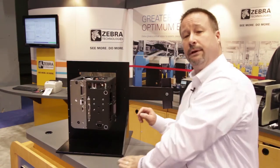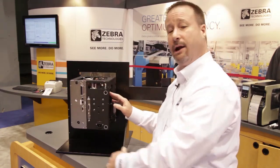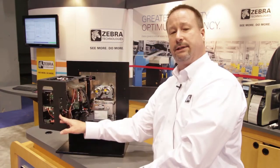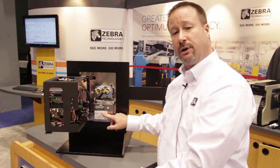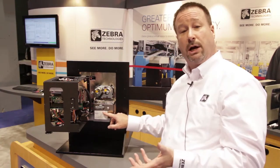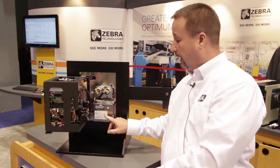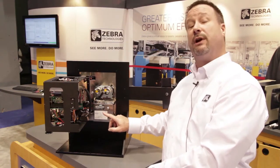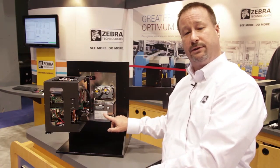Taking the back off gives us complete access via this cage system. The cage is open in every area where connections need to be unplugged, and it swings open very wide to give access to all power supplies, circuit boards, wiring, and the new modular drive system. This modular drive system can be removed with just three screws and used as a spare module or rebuilt on a benchtop. The belts are underneath this plate and are easily changed — what used to take a long time now takes 10 to 15 minutes. Even changing resolution from 203 to 300 DPI or back can be done in just 10 to 15 minutes.